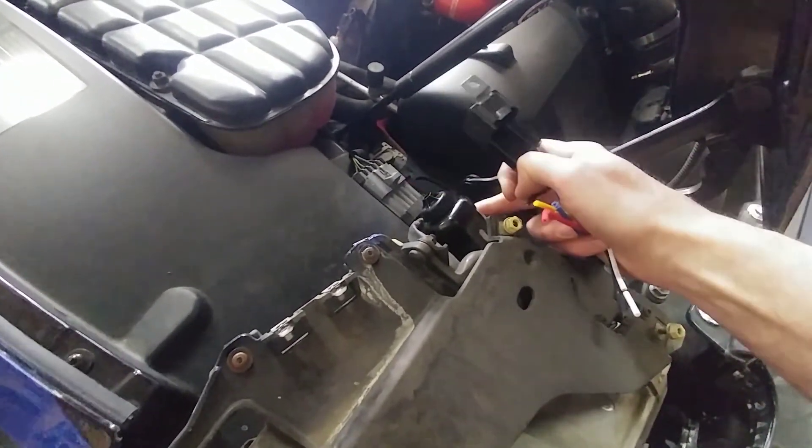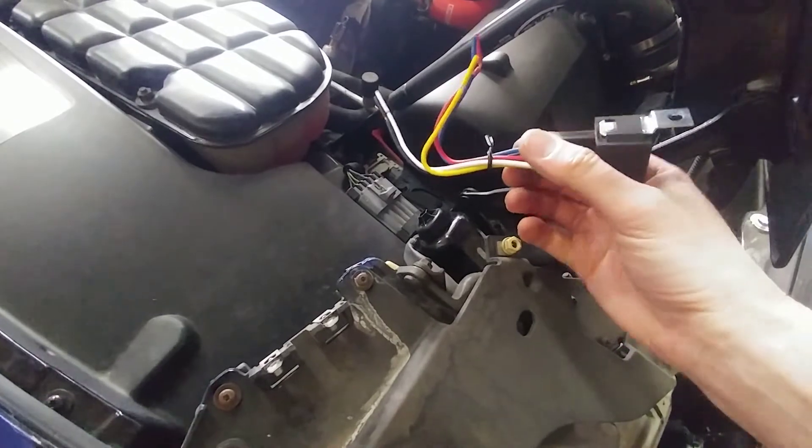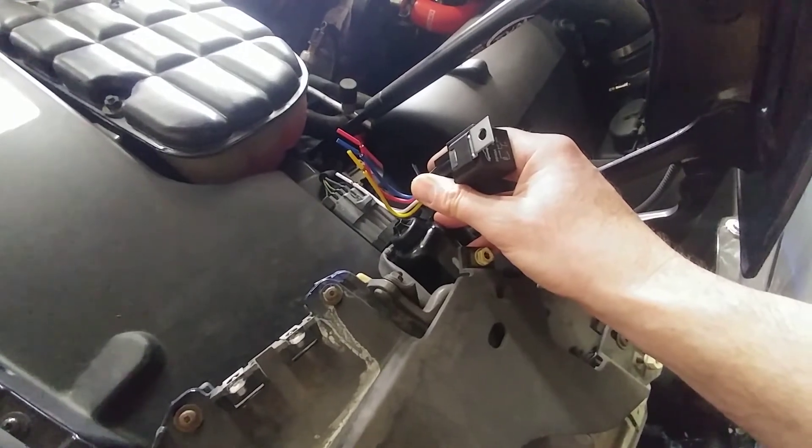You can splice in past this connector or upstream into the wiring harness — all you're going to do is solder in these ends, one to each wire, and that will add back your resistance. Once your relay is wired in place, it's going to work just fine. Just figure out how you're going to secure it so it's not dangling around. The relay will often come with a small tab — you can zip tie it to the harness, solder in the ends, tape it up, and it'll be great. All your lights will work and you'll have very bright LED headlights.